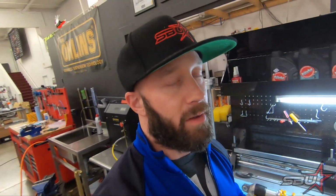And so what we do with a Supermoto shock like this one, that starts off life as a motocross shock, is we're gonna figure out what length we want, and it's typically gonna be shorter. Not everyone does that. Like a factory KTM, which is 450 SXF based, they actually use basically a standard height suspension on that bike because the guy that rides it prefers the bike to simply be taller. He's kind of a bigger guy and that kind of thing. So that's not something we typically do, but it's not unheard of.